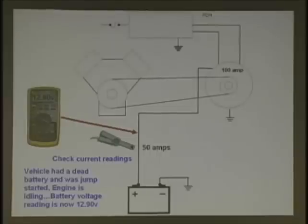And where are you going to pick up that amperage from? From that wire coming off the alternator to the battery. The big wire. By the way, you guys that have AVRs or volt amp testers, VAT40s or whatever is out there, that's where you're usually going to put your clamp around that wire, to see what the amperage is. That makes sense. Okay, next up.